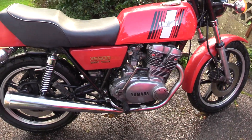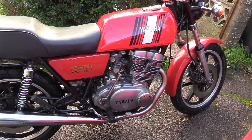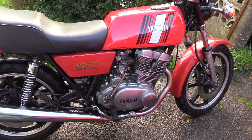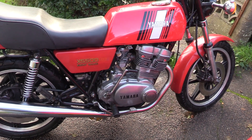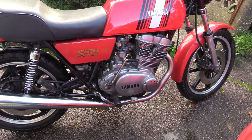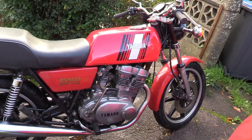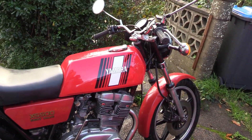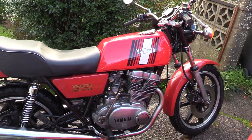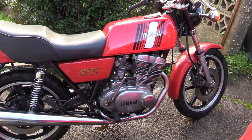But in its time it was something a bit special. It's double overhead cam with a balancer shaft and a 180-degree crank — what they call a rocking couple. So as one piston comes up, the other goes down, which gives it an uneven firing order. When you're plodding up the road it can sound a bit like a single, but obviously it's a parallel twin. Performance is okay — about 48 horsepower. It's not a particularly sporty riding bike; I think the XBR Honda I've also got is probably a bit more lively.